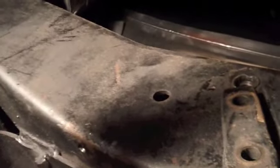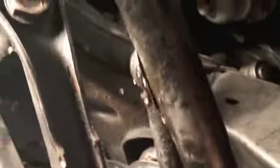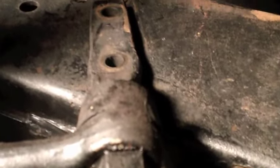Okay, now let's get things moving. I'm going to do a lot of starting and stopping here. Remember, to get the oil pan off, I took the idler arm bolts out so I could drop the arm down. Now that the pan is back up, we'll put those bolts in. I'll torque them later, but I'll just get them in there so the arm is out of my way for now.